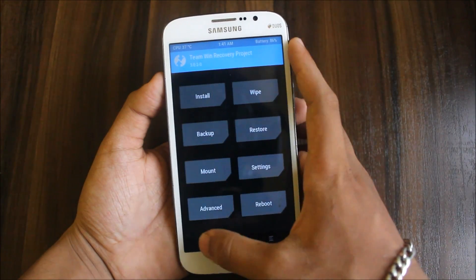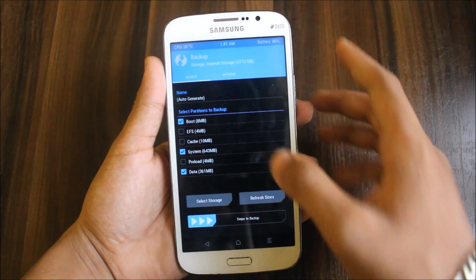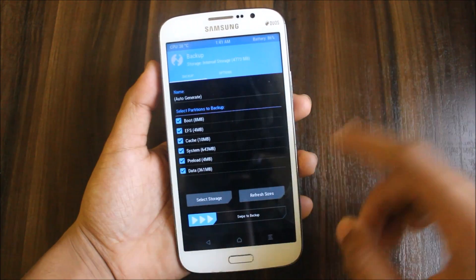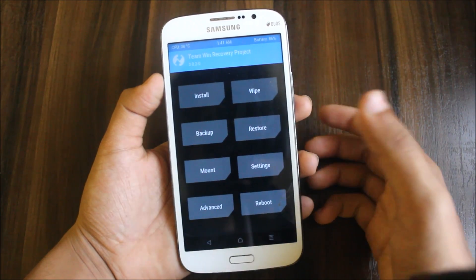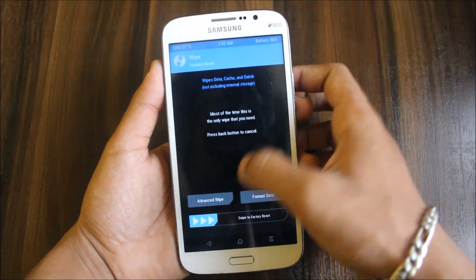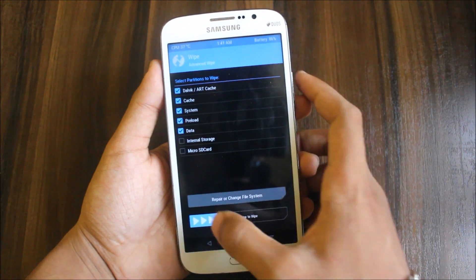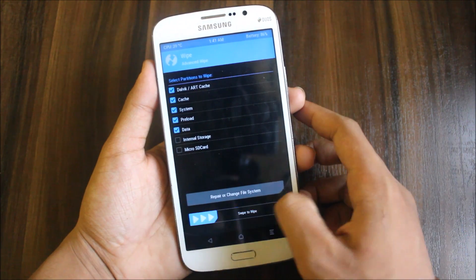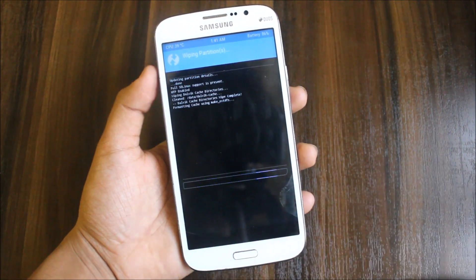First, reduce the brightness. Now you can see properly. First of all you need to go to wipe. If you want, you can back up your user data to your internal card. I don't have a microSD, so just go to wipe — wipe system, preload, and data. No need to wipe the internal storage or SD card.